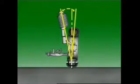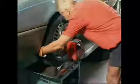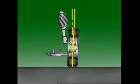The angle between the steering axis inclination and the camber line is called the included angle. It is a diagnostic angle. Since the steering axis inclination is not adjustable, if the camber angle is correct, then the steering axis inclination should also be correct — that is, it should match the specification.